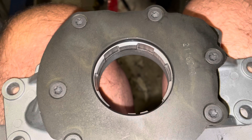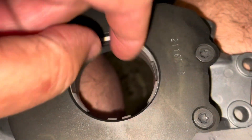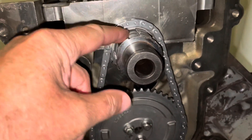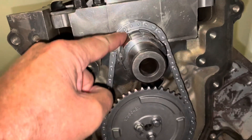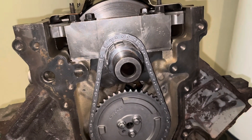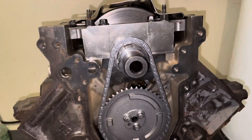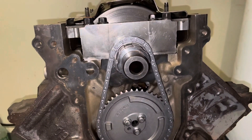There's no need to adjust this oil pump when you put it on the engine — you just put it on and go. The reason I'm talking about this is there are a lot of videos on the internet where people are shimming this oil pump, putting shims in a triangular fashion to center this gear on the crankshaft tube gear. They center this piece on that and then bolt it down. Well, that's a colossal waste of time, because GM wouldn't design something that required a meticulous shimming process. It's obvious this gear is going to move to wherever the pressure puts it, so when you set it on and bolt it on, you're done.